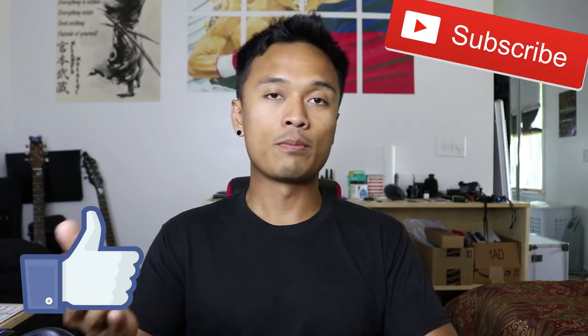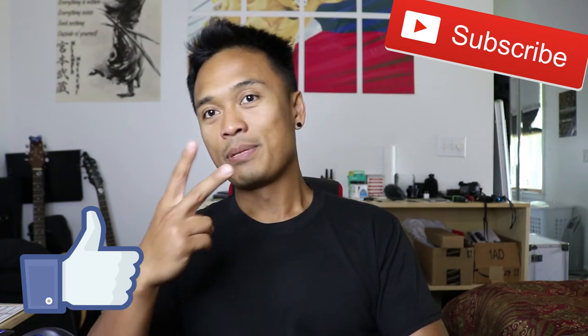Thanks for watching. One final thought before you go: the bolts I replaced are non-critical bolts. For motor mounts, suspension parts, or anything structural, I do not recommend using store hardware — make sure you get those directly from the OEM or an OEM-grade equivalent. I hope you enjoyed this video. Make sure you give it a like, subscribe, and share it with any friends who might benefit. Until next time, peace out.